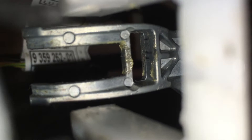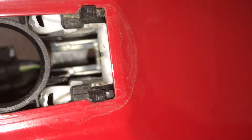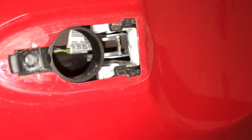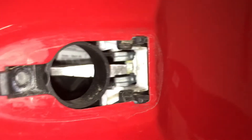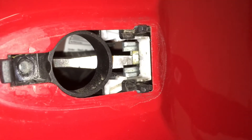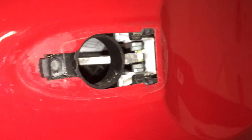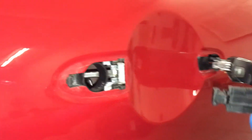This is a close look at the release lever inside the door. The vertical piece circled is the spot to position the screwdriver tip, which you will insert through the access hole in the door jamb. Once this lever is pried all the way out, the screwdriver can be shoved forward through the slot in order to lock it into place.